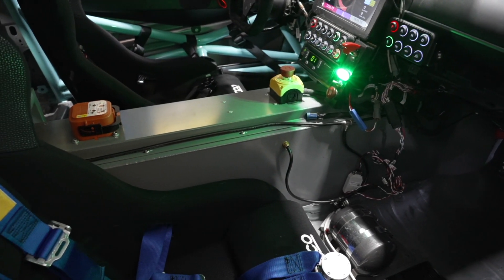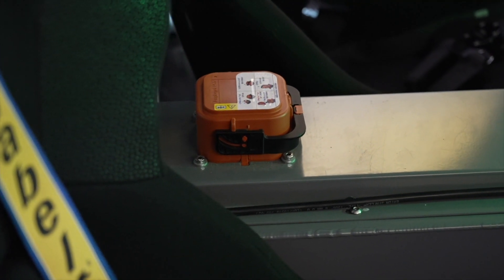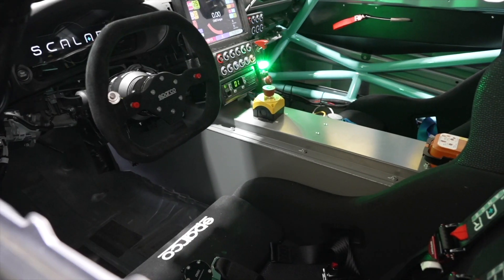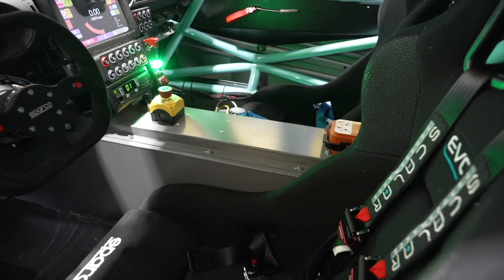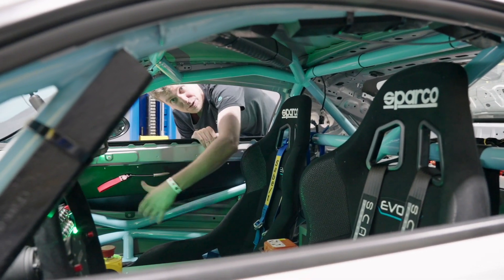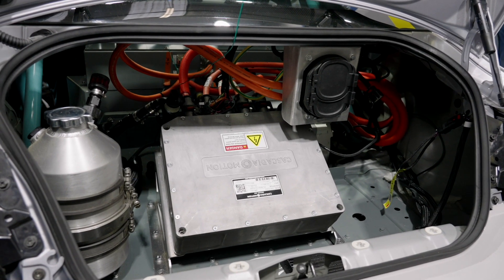As you can see, the transmission tunnel is the battery up here in the middle. There's the main service disconnect, which acts like a big circuit breaker for the car. The status light and e-stop are also on the side of the car. The battery pack runs through the tunnel, and the bulk of it is in the back seat area — that's how we achieve the 55-45 weight balance, by moving most of the cells to the rear.